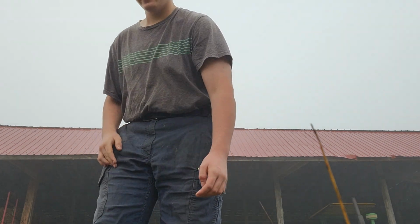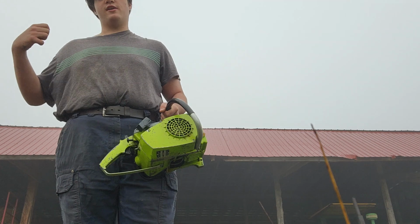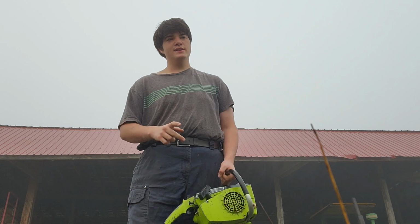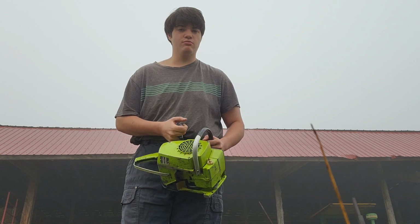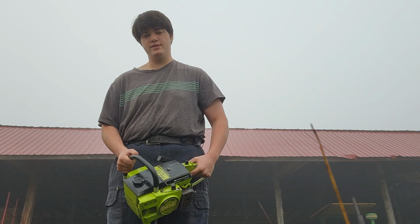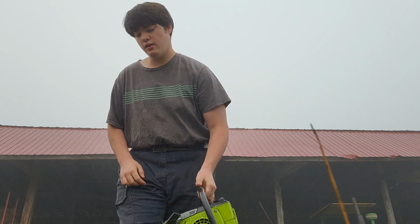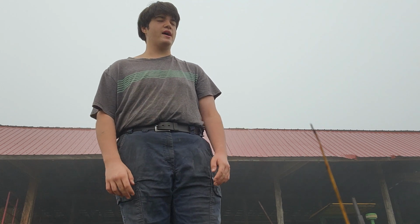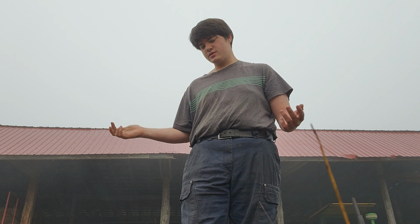About the lockup thing, I took the flywheel cover off, it pulls just fine, no issues whatsoever. Retracts, you pull it, retracts. There is compression, but it's like half of what it was before, and it's weird because in my first video, it had really good compression. I'm not sure what happened to the compression, unless there's stuff missing, but I don't have any spare parts for these. I just had a coil that I replaced in it, and it seemed to work a lot better until the tune-up went bad. This sucks. It's kind of weird.